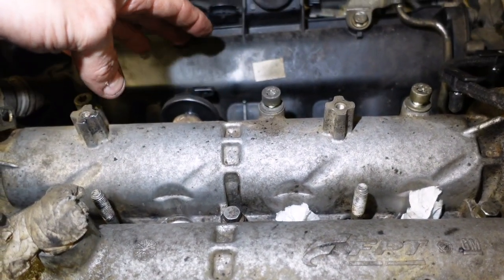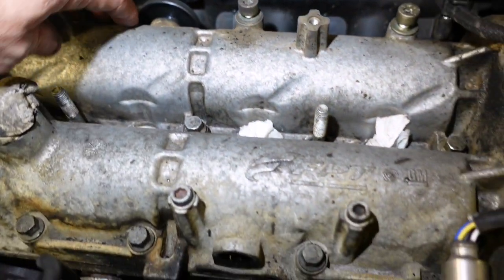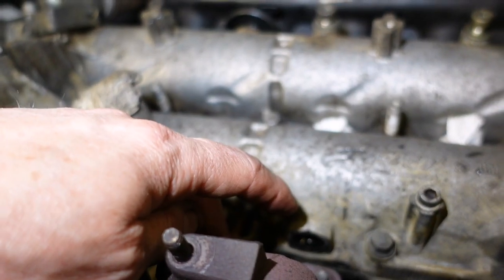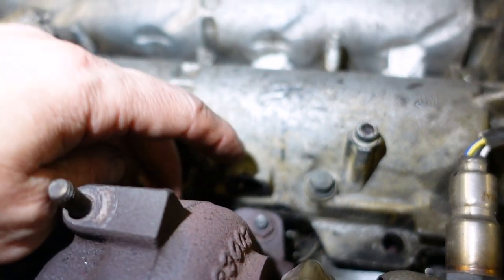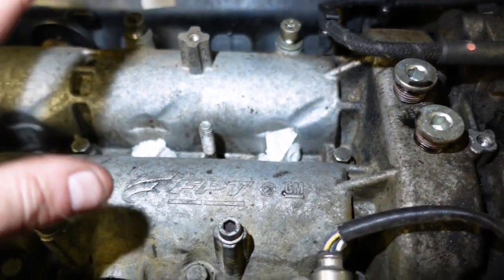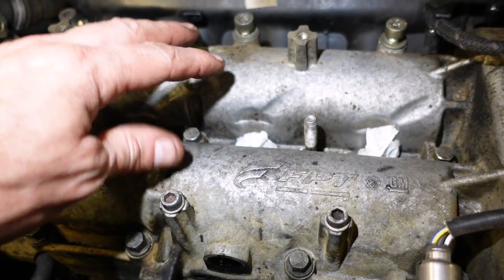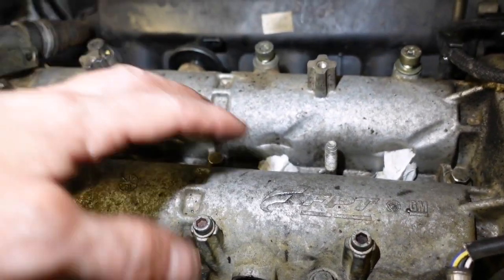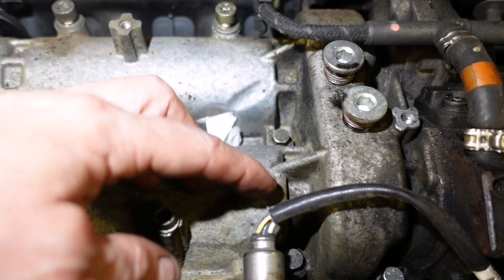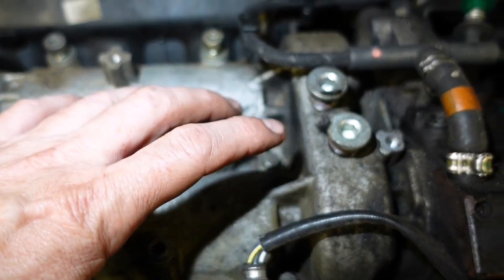If you can get the two locking pins in, by all means do so. But in this occasion I'm happy enough to do this with just the one, and just check to make sure this is in the central position. If this had a broken chain you'd be taking the cam carrier off anyway and time the two cams up with the carrier removed - so it doesn't make any difference then. Just another wee thing to keep in mind - caught me out one time.